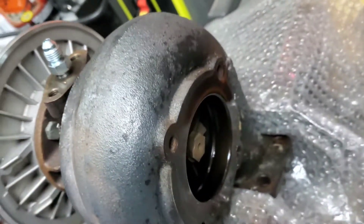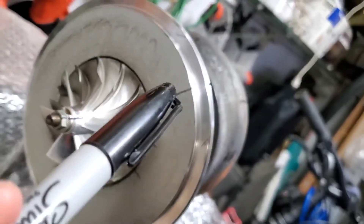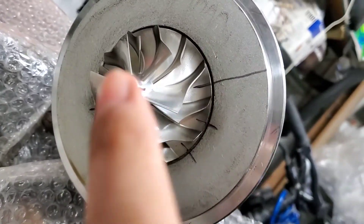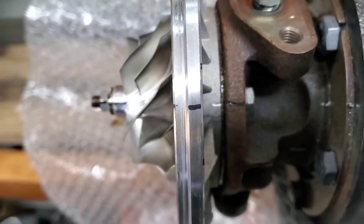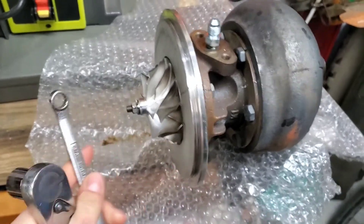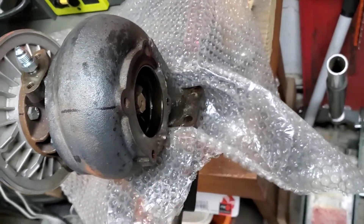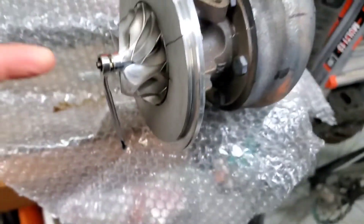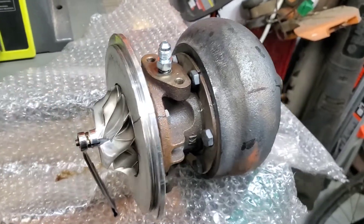The way I like to line things up is to have at least three lines — your main line and then two others. I marked all the way down the shaft so everything is completely straight and lined up all the way down the turbo. It's a 3/8 wrench on one side and a 5/8 socket on the backside, at least for this 5831 turbo. Make sure you're going clockwise and not counterclockwise to loosen it, because I almost just did the same thing.